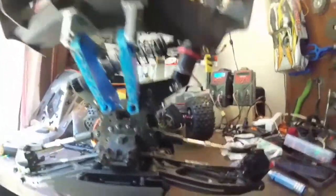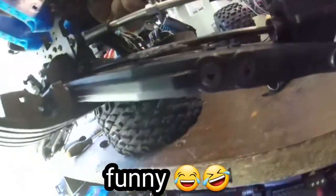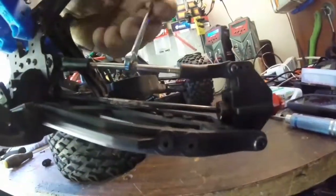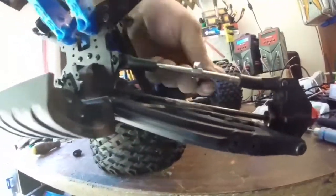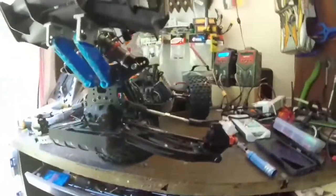Now it's adjustable up here. I can turn those in — it's a seven millimeter, it fits on these. Turn these in a little bit, because you don't want your wheels angling funny. Excuse the kids outside — even though there are two autistic kids and one of them is very loud. It's going the right way. The more I'm going to take the wheels on, it's easier to see. That's close enough. So I'm going to put the shocks on, the sway bar link on, and then I'll bring these back as I put the wheels on.